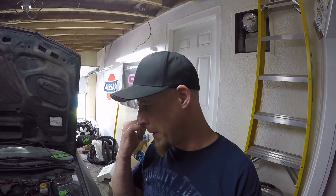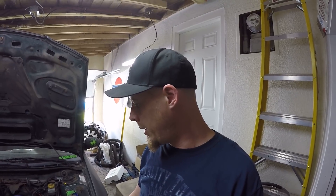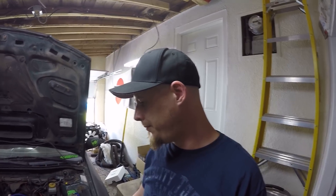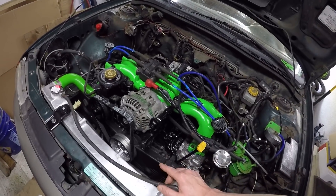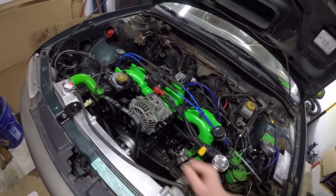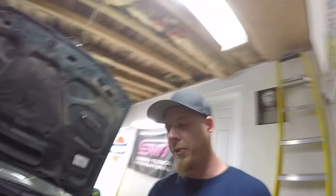I also had the idea that maybe it's an oil filter, because a lot of oil filters have a check valve in them. I even have an extra filter here I could have tried, but I've never seen an oil filter do that in probably a couple thousand oil changes I've done. So I'm going to start taking the front timing covers off and the crank pulley and get down to the belt to see how accessible the pressure relief valve is without actually removing the timing belt.